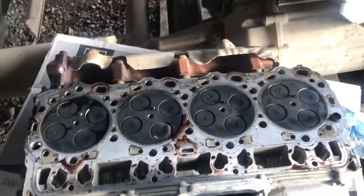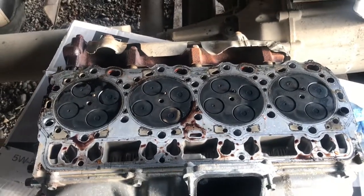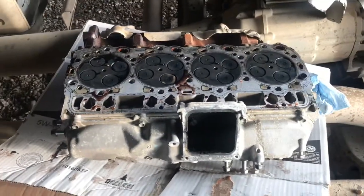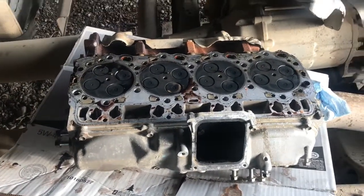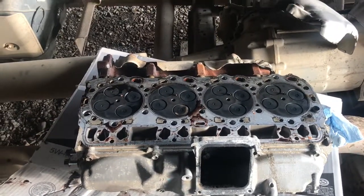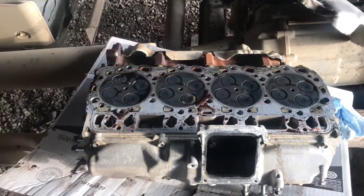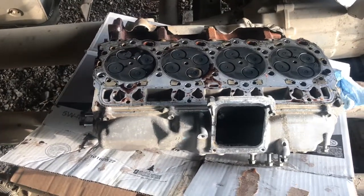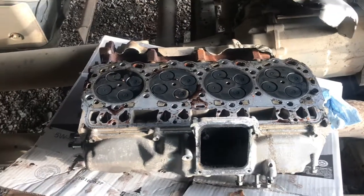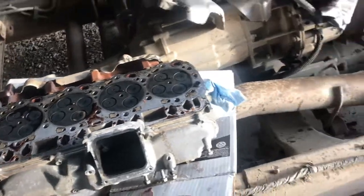A lot of times when I did my Ford the problem got solved, but it was really bad — you could just hear it singing a song as you're driving down the road, squeaking out the relief valve in the reservoir cap. But there was nothing visible. This one here I'm quite confident that's where it was leaking. We'll deck the heads, new gaskets, head studs, and they're doing the stainless fire rings in there.